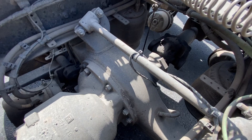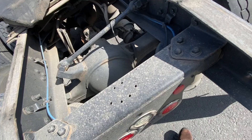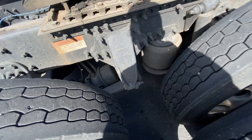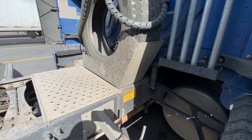The driveshaft — all you want to do is just look for anything unusual: brakes, lines. Make sure the airbags are good — they're good to go. Look it over. Drive shaft — make sure everything looks good, nothing loose, no debris. Check the lines — you'll normally see a leak somewhere if there is one. Make sure the low bars are secured on there.